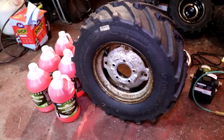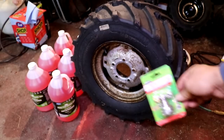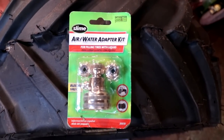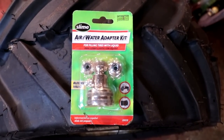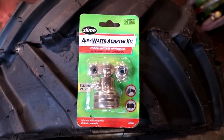Okay, so here are some of the tools you are going to need to do this. First is a valve stem tire tool — this removes the core from the valve stem that will allow you to put liquid into your tires. You will also need one of these air water adapter kits. You hook it up to your hose that is connected to your pump, then there is a little piece that you screw on to your valve stem, and this is what will allow liquid to get into your tire. There is also a little burping button on there to relieve excess air pressure that escapes from your tire as you fill it with liquid. I will leave a link to this product in the description below — this is a must have for this process.